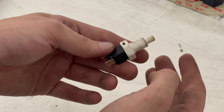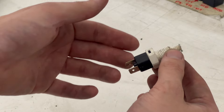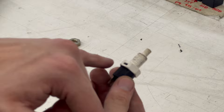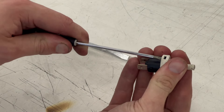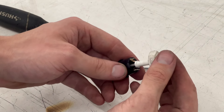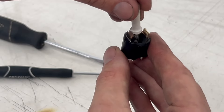All right, our brake lights came on. I did see a little bit of a spark when the second prong went in, so I think that confirms our switch is the issue. I essentially jumped that switch and the brake lights are on — when I pull this out, the brake lights will shut off. I did do this exact repair a year ago, which led me to believe this would be our problem. Of course, I wanted to do that testing just to confirm.